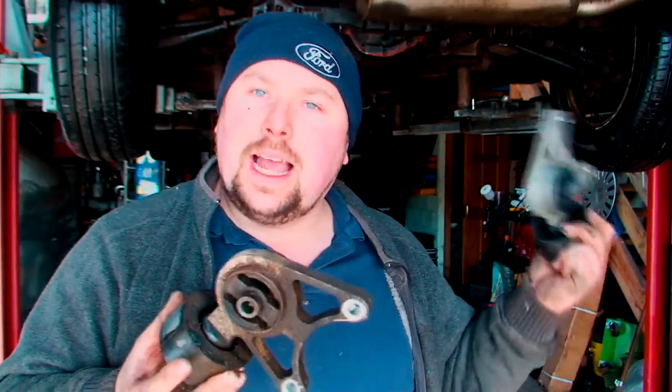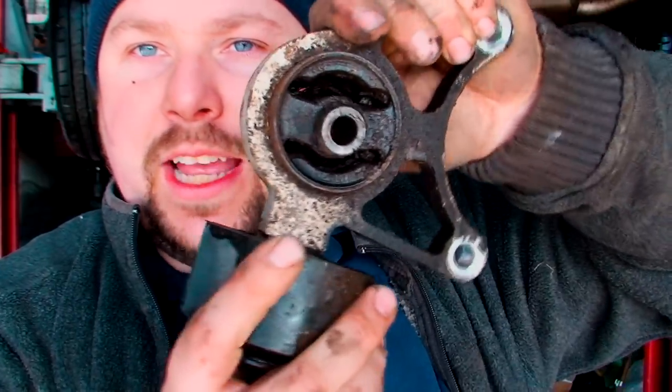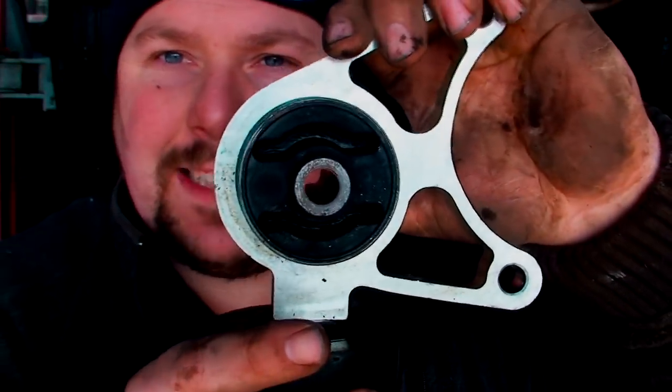These weren't as bad as the first one we took out, but I can still move them a lot without even putting much pressure. Compared to the new one, which I can't really move at all — they've gone weak. Putting a good one on the front and leaving two weak ones on the back will just destroy the front one again, then you'll have to replace them anyway. You're as well off replacing them all at once. It saves money in the long term, and if it ever got really bad you could smash the back diff, the transfer box, the drive shaft — it would end up costing absolute thousands.